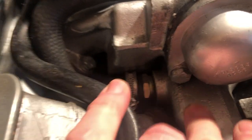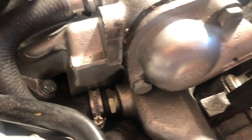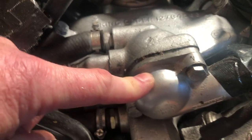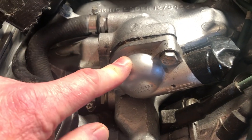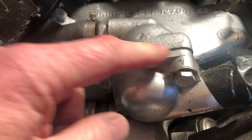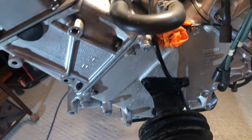The water pump is way underneath there — which is actually on top of the engine — bolted down, and you've got a 12-vane impeller in there that passes the water around. Above it, as we looked at recently when changing the water and antifreeze, that's where your thermostat is based: two bolts to hold it in with a gasket in between, and that's your water feed going to the radiator.